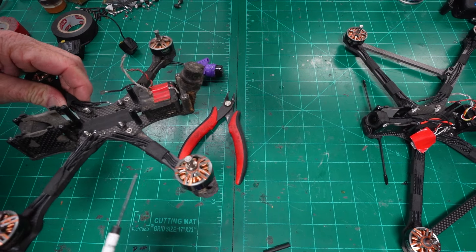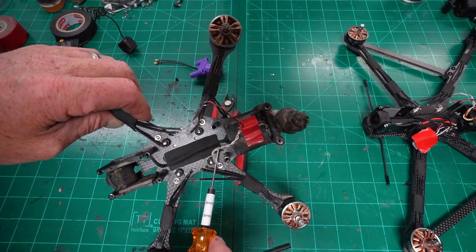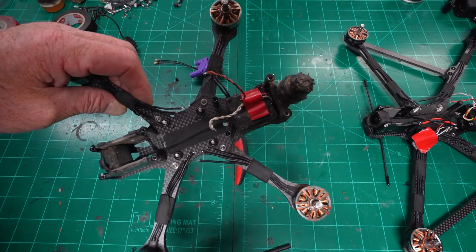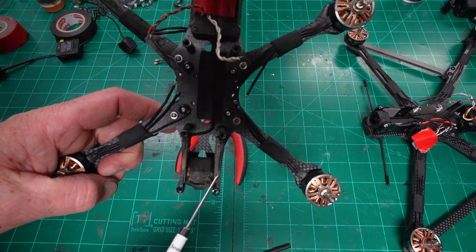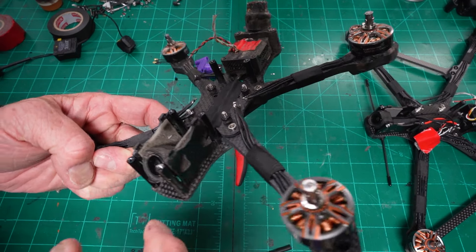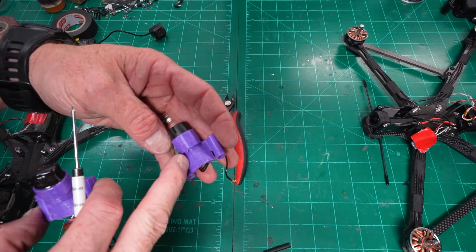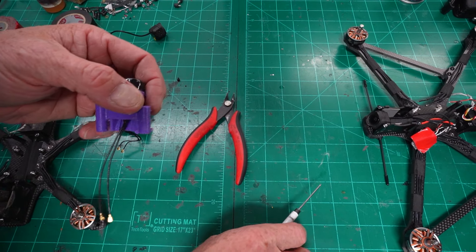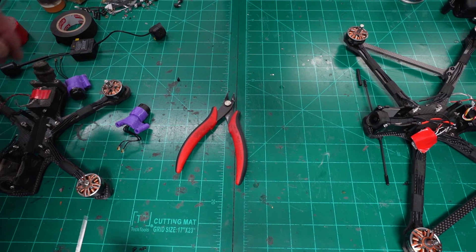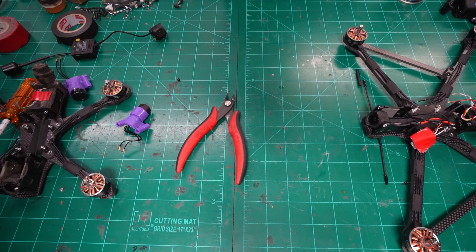Recap: Double-sided 15-pound 3M tape to secure the O3 air unit in place — I tape it to the frame because I use slightly higher standoffs, but you can run it either between the flight controller or the ESC, shooter's choice. Two strips or one folded over, single strip on the other side to lock the camera in place — or use the Apex kit they sell now. TPU mount for the Apex, antenna squeezed in, modified and trimmed the straw, E6000 to protect it. That's about as bulletproof as you can get. Any questions, hit me up — I hope this is useful.